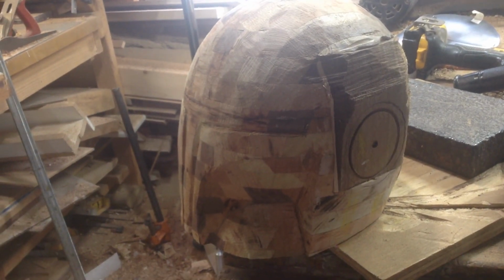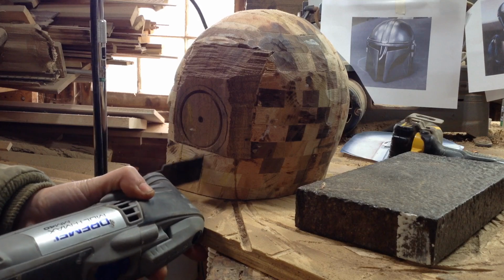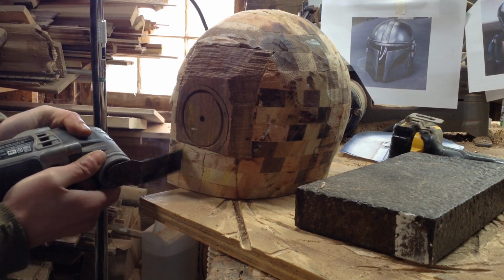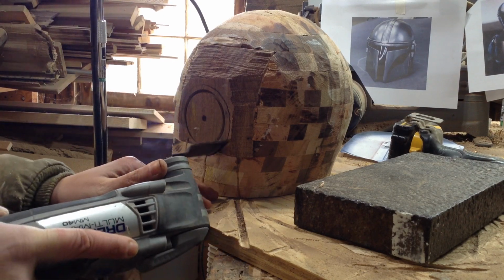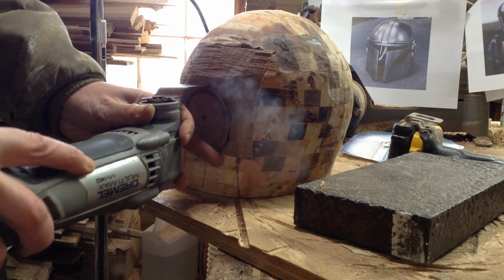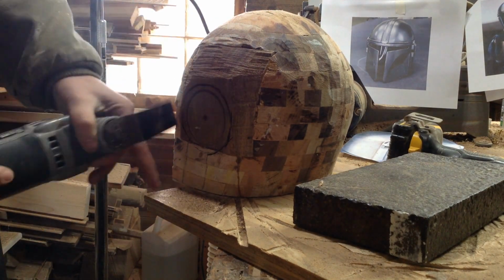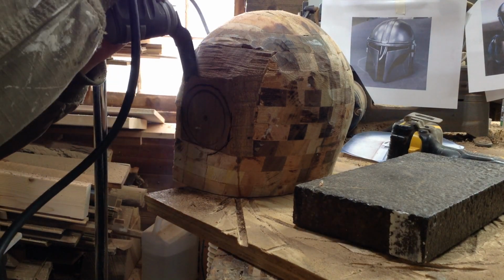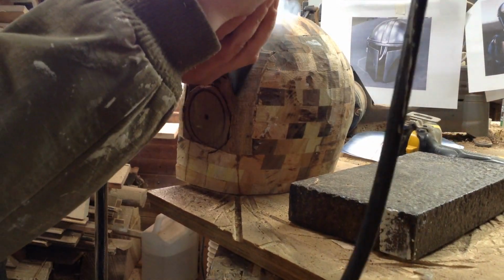You could see with the hole saw, I ended up marking the outer rim of the ear, because that is what the outer rim of the speaker is, which is 3 inches. So I used a 3-inch hole saw bit to mark that outer ear, and then I'm just going to follow that line with my oscillating tool. And that's the easiest way to make that stop cut in order to remove that material. So I could go down with the oscillating tool and then remove the bulk.